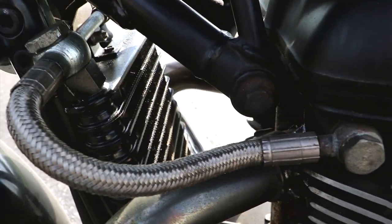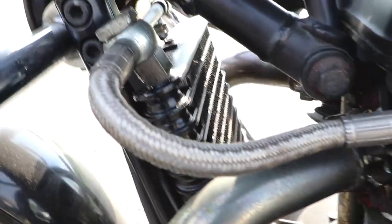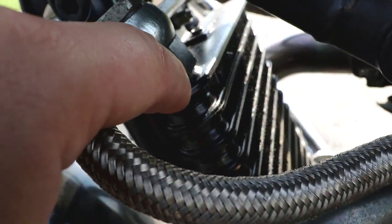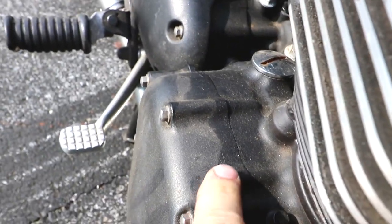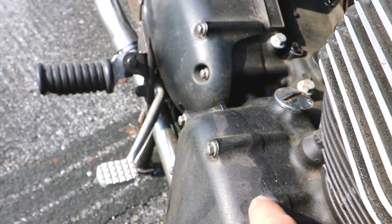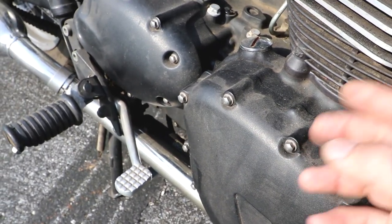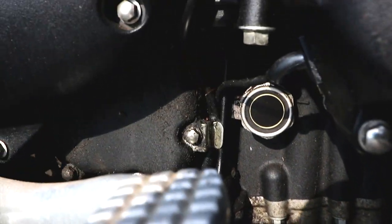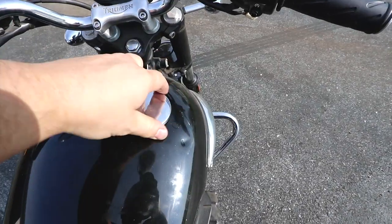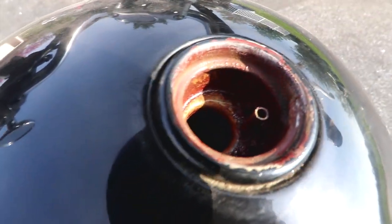With that being said, I couldn't really start the bike up. He also said there's no gas in it, the battery was dead, and the carbs probably need rebuilt. So I'm kind of taking a chance on the whole deal, especially because there's oil all over this case right here. It looks like the oil was blowing out — that's a clear indication there's too much oil in the crankcase or the case is leaking. Sometimes the gasket fails but that's not very common. So I checked the oil and lo and behold, it's got way too much oil in the crankcase. Inside of the fuel tank is definitely going to need some attention — it's a little bit crusty in there, possibly from someone coating the inside.